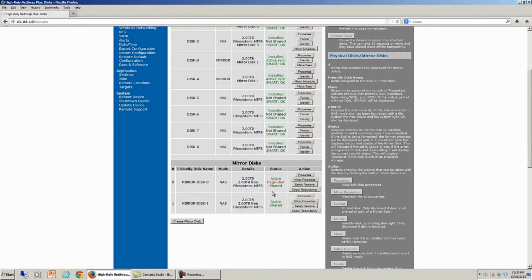So this is for taking point-in-time snapshots. This would be if your user forgot to swap drive 2 at a point in time, and you wanted to make sure that that mirror had been done once per week and then dropped back offline so that it has that data safely away from where you could have a virus or where a user might accidentally delete a backup job on that volume.